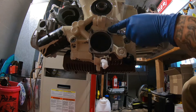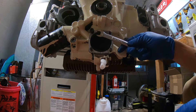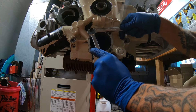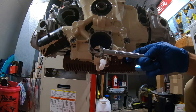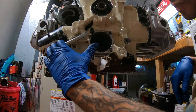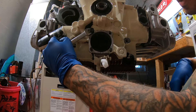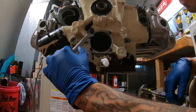It's coming out super smooth. Jam the rear nut against the front nut — these are 13 millimeters, so just come back to the rear nut. They both came out super easy — that was my biggest concern, getting these studs out of the block. The fact that they came out this easily means the whole install should go pretty smooth now.